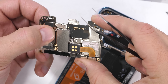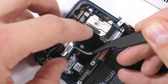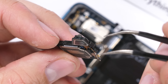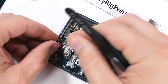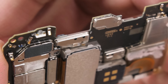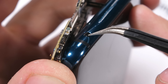The top earpiece is pretty unique — it has one little screw holding it in place. The interesting part is that the bulk of the speaker is placed far below the small grill location, which is actually a good thing. Bigger speakers allow for better sound, and Huawei is just utilizing that extra space below the grill. One thing that most smartphones don't come with these days is an IR blaster — literally just a remote control built into your smartphone. It's got an infrared LED built directly onto the motherboard, which shines through the opaque plastic circle on top of the phone to communicate with your TV, VCR, or DVD player.